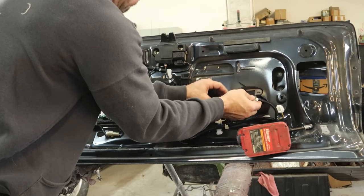We'll pop our little grab handle cover open and pull out the two Phillips screws in there that hold it on. With that finish panel out of our way, it gives us a little bit of a shoulder to work on with those bolts. So we're going to use our electric induction heater to heat up the nuts that are actually welded onto the deck lid and get our frozen bolts out. These are available in the Amazon store if you are afraid of fire and don't want to use a torch, or like me, don't want to melt all of the rest of the paint on this deck lid trying to get these bolts out. We got one out, we'll do the other one. Just press the button — it heats up the coil at the end and whatever's in between it. Find the coil that fits around the nut, heat it up, and pull the bolt out of it. Works pretty well.